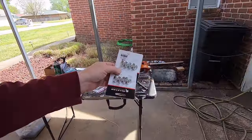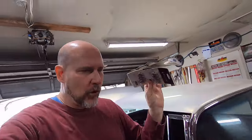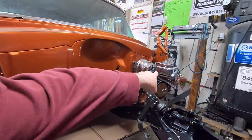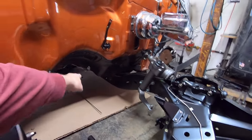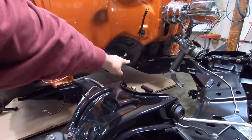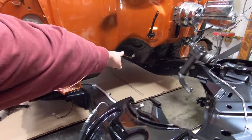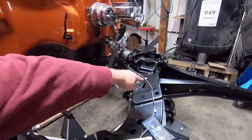The timing on the brake line clamps couldn't have been more perfect. I needed a few more 3/16ths brake line clamps to finish the brake line. I'm going to do that today — the brake lines will be bent, plumbed, and done. I've got to build the one that goes from the rear brakes to the master cylinder, coming back down the firewall and along the frame. I've already done the rear brake line section and it has a union on it, so I just need a piece to go up from there.